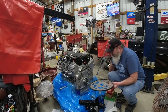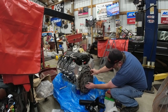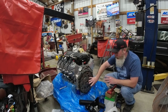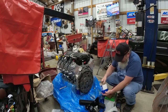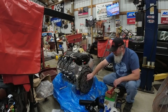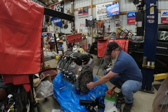We have future plans for expansion of this shop, but those are far in the future. Right now we're going to attempt to get this thing pressed on, engine side going towards the engine. The flex plate slides onto the first ring mark and then it stops. I'll spin it, line up all the holes, start all the bolts, and evenly tighten it down until that presses on properly.